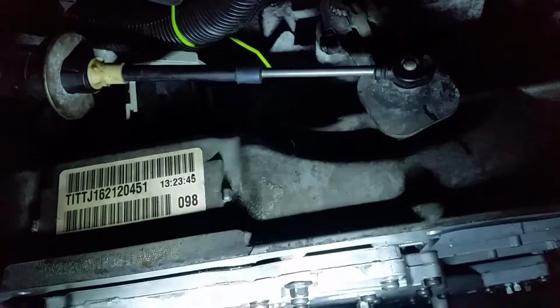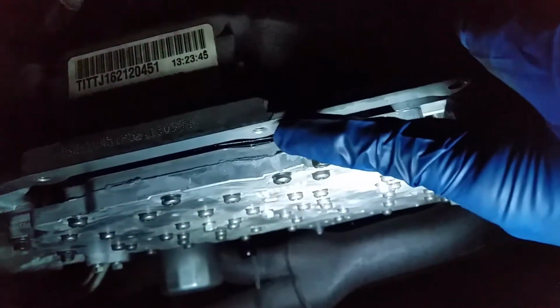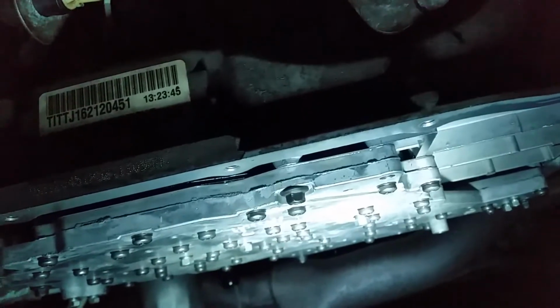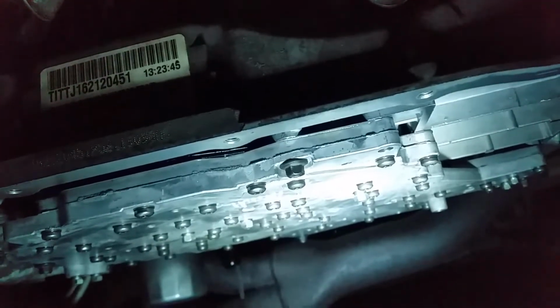A quick search on the internet, it was kind of hard to find what the actual torque spec was, but 100 inch-pounds seemed reasonable. Putting back the valve body, I kept 2 of the screws close by in the pan holes, and with one hand lifted it up until it wiggled back into place. Once it leveled out, I put the 2 screws on either side to support the weight until I could pull my hand off and get the rest of the bolts in.